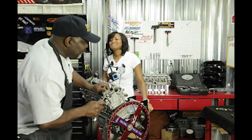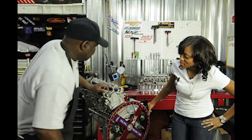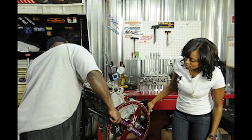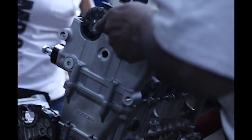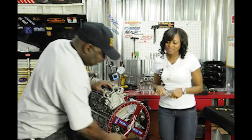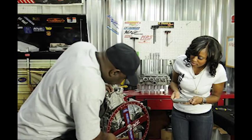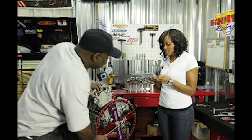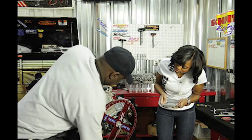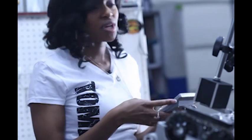What's a smidge? It's just a little bit, just a hair. So now we moved it. I'm going to find the exact spot we need to be at. Tighten it and hold it right there. Now we check it again. The first number we're going to put in is 90, plus 132, divide by two — 111. We want to get 110, so we're going to go back down just a little bit more.